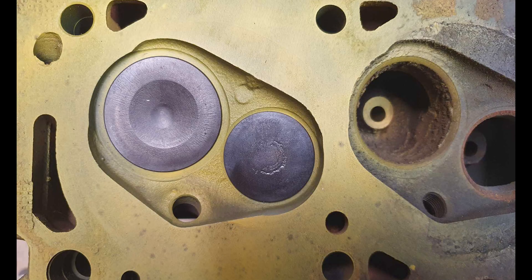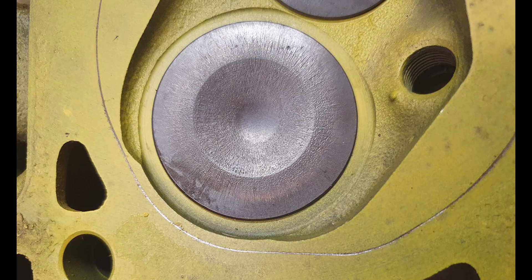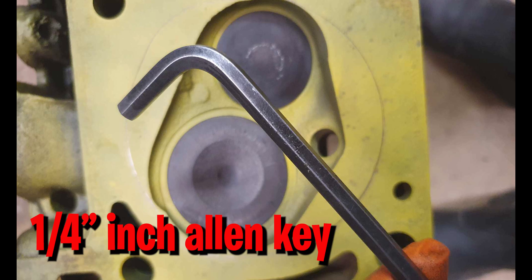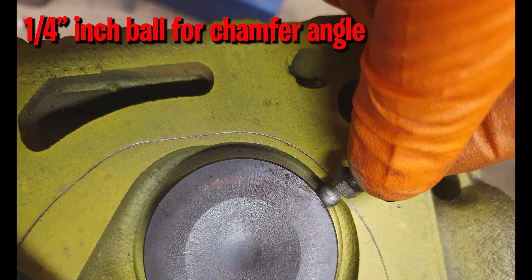The way Craig goes about this: first he paints up his cylinder head so that when he puts his head gaskets on he can scribe where his head gasket opening is around the combustion chamber without scratching into the cylinder head surface — because you don't want to do that, otherwise you'll be milling your cylinder head. He starts with just a light coat of yellow paint for visibility. You can see the scribe mark around the head gasket opening, which gives you basically where your tolerances are and the amount of material you have to work with for de-shrouding the valves. You don't want to exceed this line.